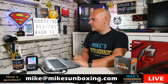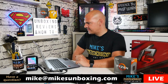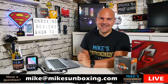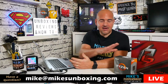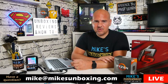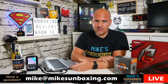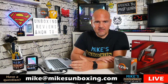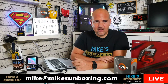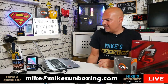Oh, Danielle Emberley. Okay. Trying to understand how most people run AMD computers. No overclocking, manual OC, using XMP. That's pretty much me. I like to be able to just use the PC. And for most people, especially with the 3000 series chips, if you put them in Precision Boost overclock mode, which is pretty much default anyway, and enable XMP in your memory, you're pretty much there. There's not really much more you can do. The systems have become so good that they just look after themselves. You can go into Ryzen Master and tweak things a little bit, but generally all it does is add a few more degrees of temperature, which at the moment is damn hot anyway. Why would you want to add a few more extra degrees to your PC? It's just pretty insane. But anyway.